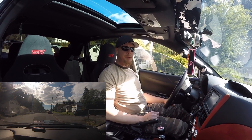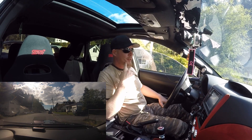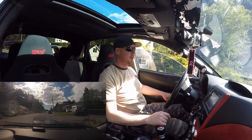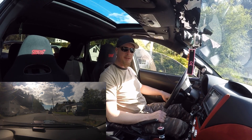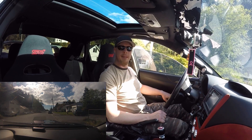Next thing for me is probably to try and pull back the gold 240 with the Forester to break the wheels loose and then possibly get it pushed into the driveway. I also want to take a look at the wagon — the idle keeps dropping really low. I've already taken off the idle air control motor and cleaned it, and I think it's heavily over-fueling and causing a low idle. It's got a slow start to it too. I want to run the ground from the battery up to the engine, which I'll probably get done very soon. So all that could actually be the next video before I dive into the 240 stuff.